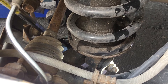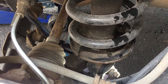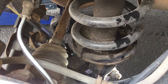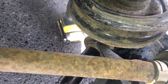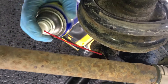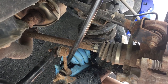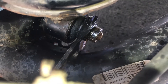For now, we're just going to try to use a breaker bar and a 17mm impact socket. I've chosen to use an impact because standard sockets can actually break under the pressure that's required to remove this screw. I also recommend using some WD-40 to help loosen up this screw. With luck, using a breaker bar will allow you to start to turn this screw.